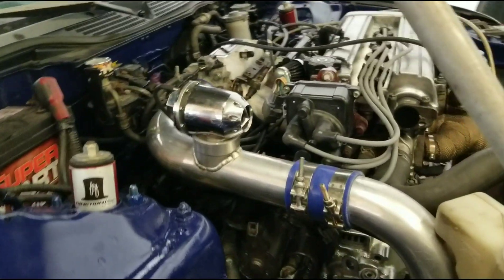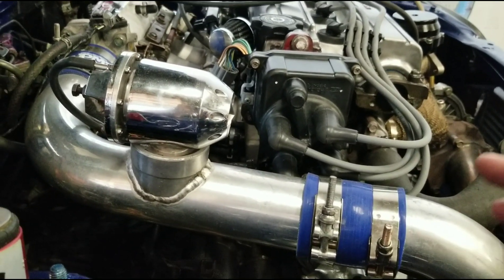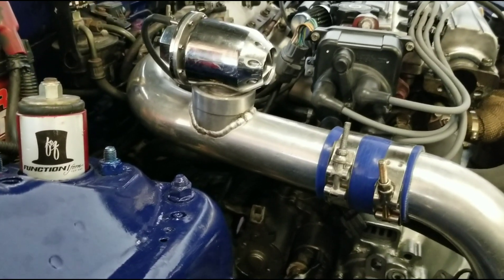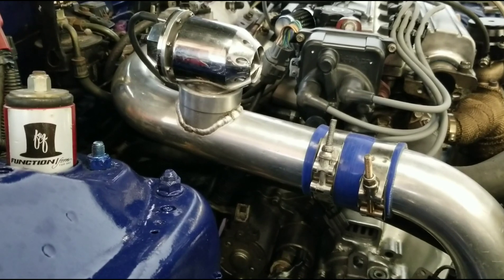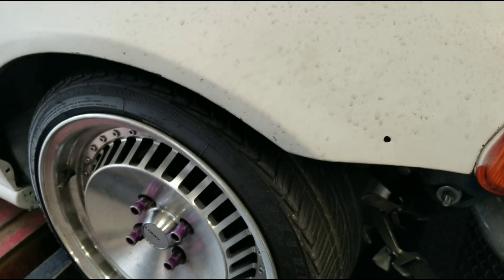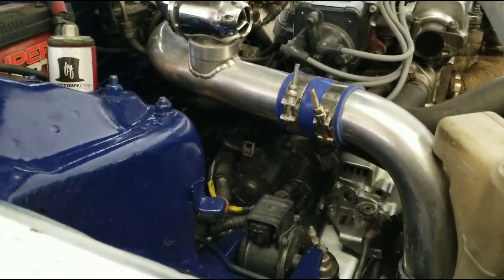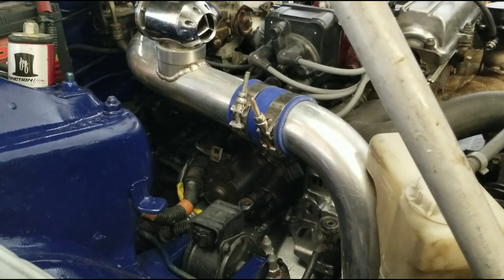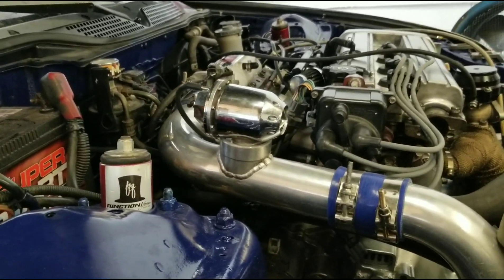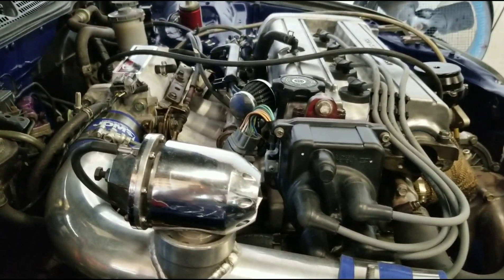We're back inside and having a weird issue — at about 4,000 RPM the car starts building boost, things look good, then it just cuts out. Boost cut is fine — it's not hitting where I have the boost cut set. Launch control is disabled on the dyno just in case, because if the computer can't see how fast the car is moving it thinks it's at a standstill and will enable launch control while driving. His mile-per-hour gauge doesn't work either. I get into it again — builds boost fine — I hear a random noise that kind of goes away, then I get into it again and the car won't build any boost at all.